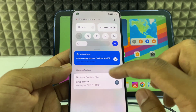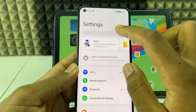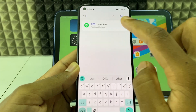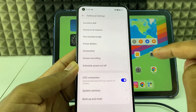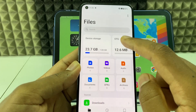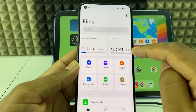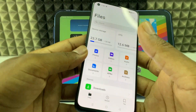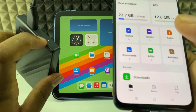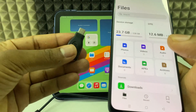Swipe down. If you don't see any pop-up, open Settings and type OTG. Open it and turn it on. Here you can see the OTG showing 1.95 terabytes — it's connected. You can see the light indication.